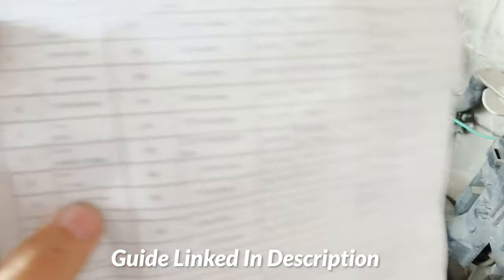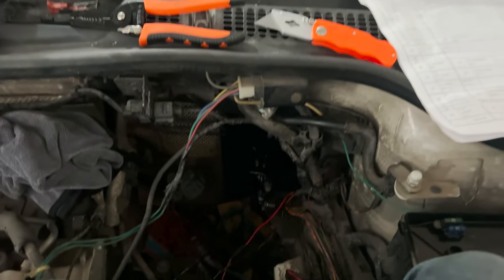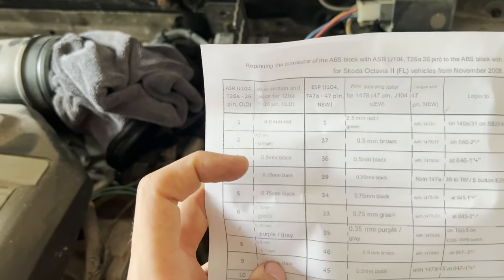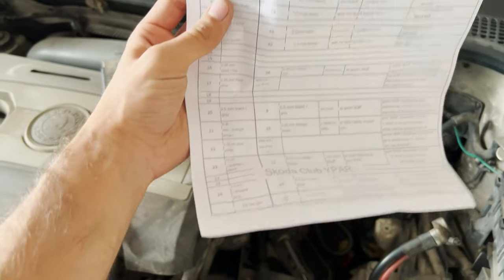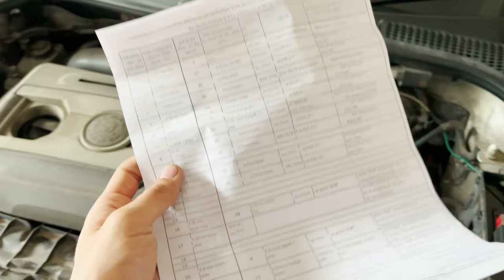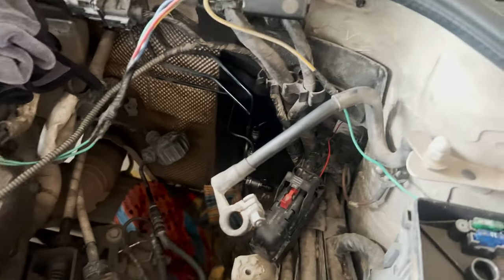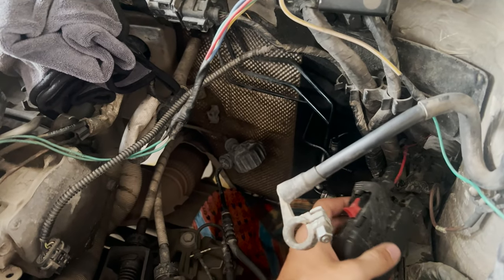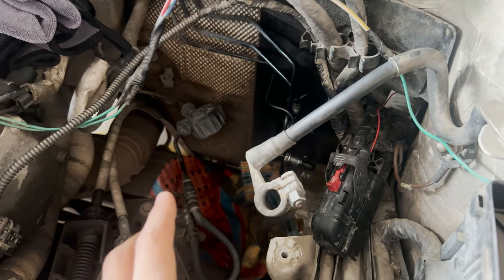Using a very helpful guide online I started the process of upgrading my ABS. I sat inside the engine bay of the car cutting away wires, stripping them and soldering them onto the new connector one by one. I have the schematic for it — it shows which pin of the original connector corresponds to the pin of the new connector. So 1 goes to 1, 2 goes to 37, and just like that I needed to cut the wires and rewire this entirely. Ideally I would want to decrimp and remove each terminal and install it in the new one, but the terminals are actually different so unfortunately we cannot do that.